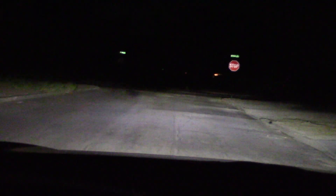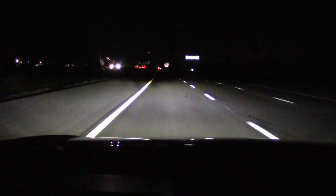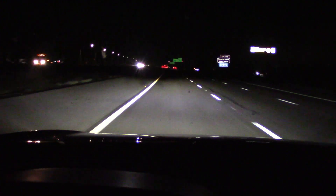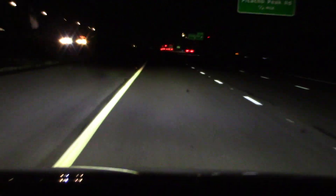On YouTube there are probably two dozen other people that tested these — they had these cars for a week. How come they're not saying anything? They've got to be driving at night. One more example: high beams on, you can see down the road. Low beam — can't see squat. It takes around 175 feet to stop a car at freeway speeds, and right here I've got around 65 feet with the low beams. I can't see anything beyond that point. It's called overdriving your headlights. If there's anything beyond this mark, I can't see what's on the road. Not very encouraging.